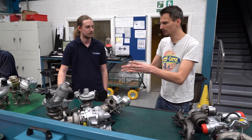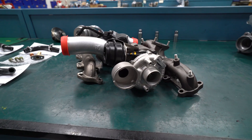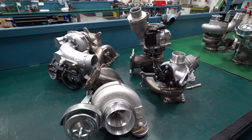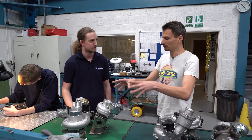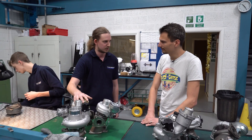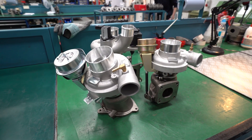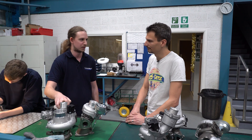There are actually different levels of hybrid turbo. Down here we've got a couple of examples of your most basic hybrid — both of these have got enlarged compressor wheels with reprofiled compressor housings to match and upgraded thrust bearings. We like to take things a little bit further: all of these have completely redesigned bearing systems. This turbo here has a completely different core and a new compressor housing. Finally, we have the God-tier turbos. In our bespoke performance hybrids, there are no reused parts from the original turbo. This gives us the freedom to use whatever bearing system we like, whatever upgraded parts we like from all sorts of different turbo types, as well as making our own parts. The benefit is uncompromised performance, but they still fit onto your car as the original turbo did, without the expense of changing lots of parts to make them fit.